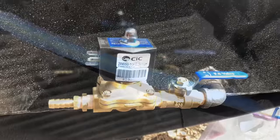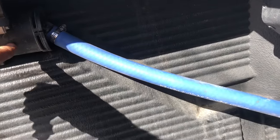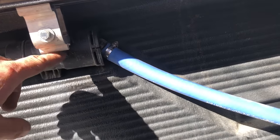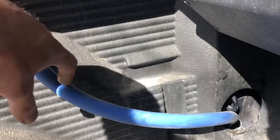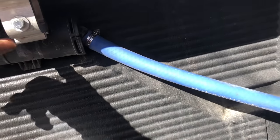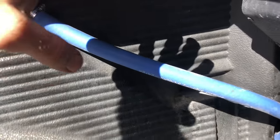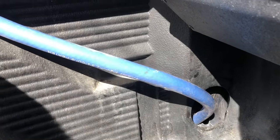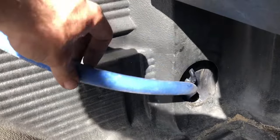On some trucks you're going to have to relocate your breather for your tank. The reason being is when your tank fills up, fuel will start coming out of your breather. With the Ford — I have this on a 2012 F-150 also — you can just let it go and it never leaks. The Dodges for whatever reason leak out of the breather, so you've got to relocate it above the height of your fuel tank in the back. That way it'll prevent anything from leaking through. Make sure you use hose that can withstand fuel vapor or else it'll eat right through it. Same with your delivery line — it needs to be rated for fuel.